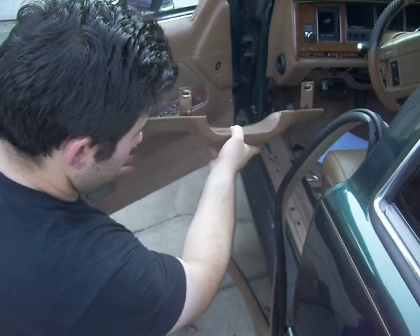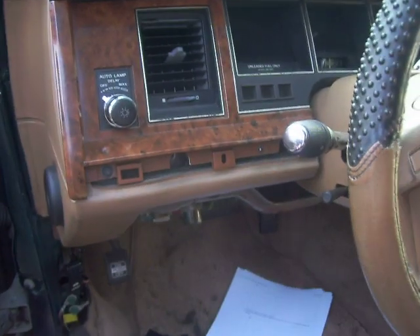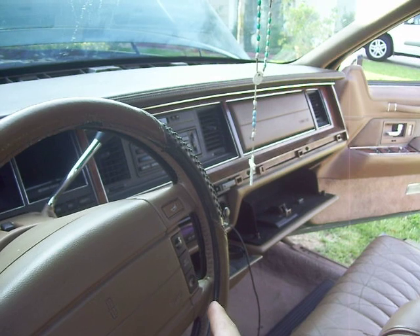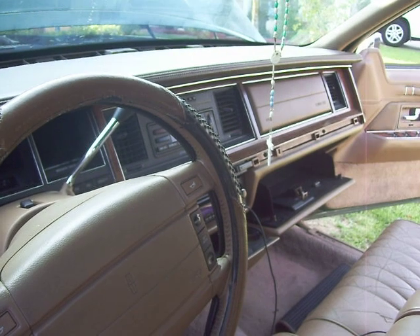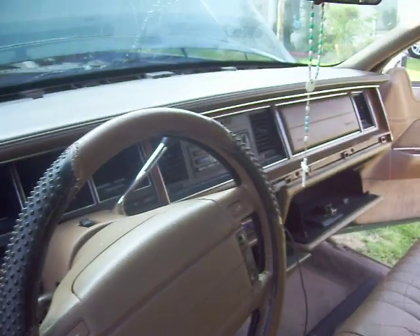What you're going to need to do is on your dashboard you have trim. If you come closer, you'll see right here there's trim you can remove, and then over there there's a larger piece of trim that goes in between the defroster and the gas fuel door. You pull that trim off very carefully with a screwdriver or a flathead — it pops off. Just go underneath and pull forward.